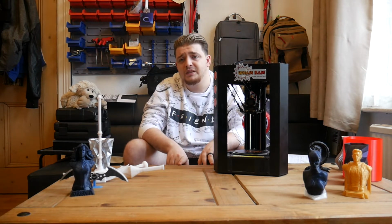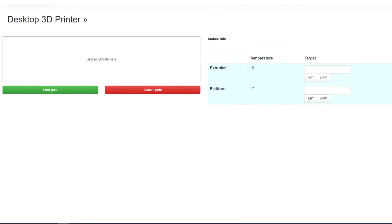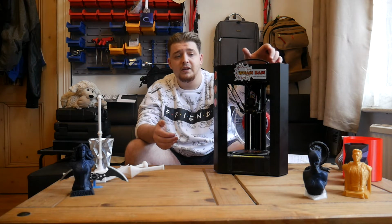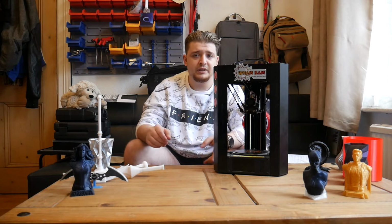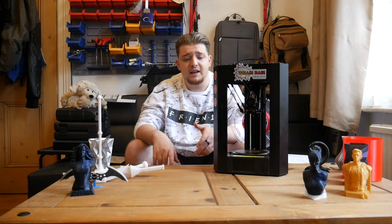Go to your computer. I think the one, it always rotates. I think at the moment for me this is 10.0.0.34. So if I go to my browser, type in 10.0.0.34, a little box will pop up saying, upload your G-code here. And you upload it, and it'll say, do you want to adjust the temperatures? And you just click print.